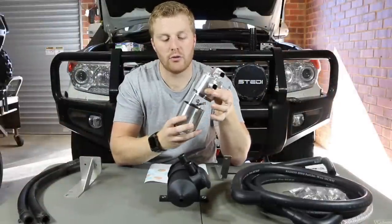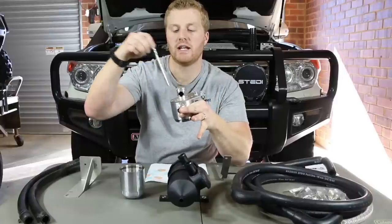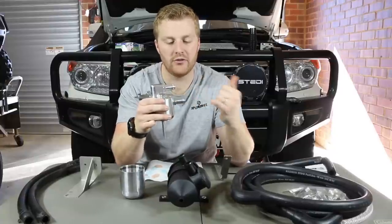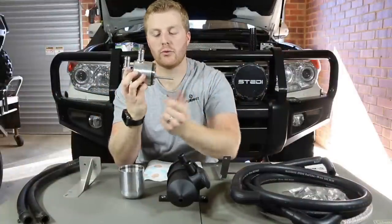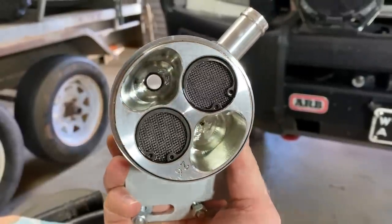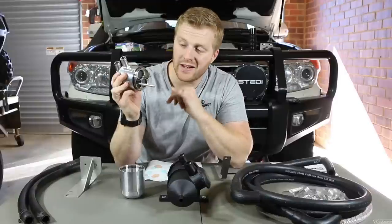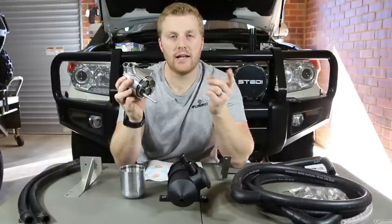Some cars, depending on your model, you can unscrew it from where it's mounted and empty it straight out. The little metal stick is a dipstick that pops into the cup to give you an indication of how full it is and when it's time to empty. It has a rubber O-ring but is aluminium construction. You've got your intake in and your outlet pipe — all this unit is doing is sending oily gases through the intake pipe and through these mesh filters. There are a couple of layers of mesh held in by metal circlips, and the oily gases pass through those filters, into the cup, and then back up through the intake line into your air intake and intercooler. That is the only filtration — those metal gauze pads separate the oily gases from the air and let cleaner air go back into your intercooler.